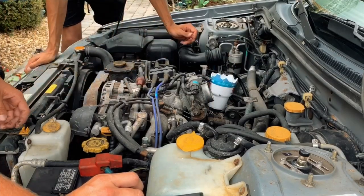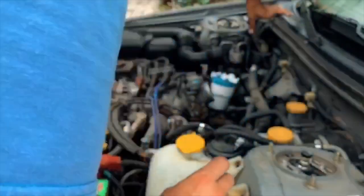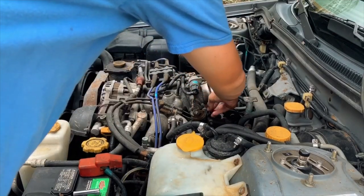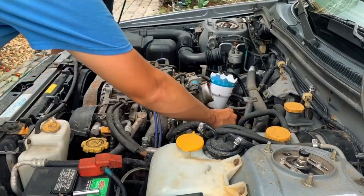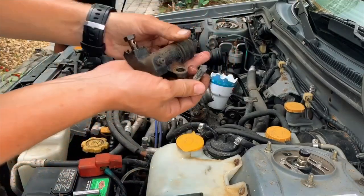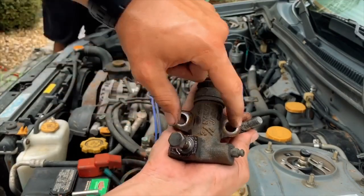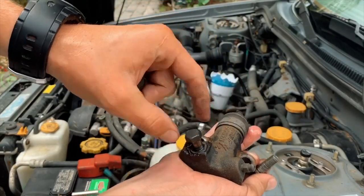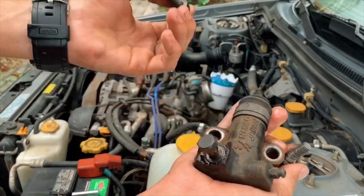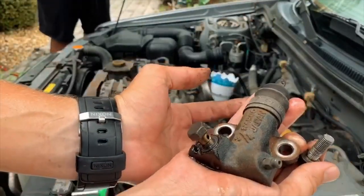It's just going to leak a little brake fluid out of the slave. So as I showed you guys, it was just those 14mm bolts and this pops right out. Save that brake fluid - as you can see it came out super easy. These two 14s and this is a 14 up top. A little bit of brake fluid will get on the transmission but other than that, pretty easy.